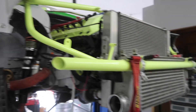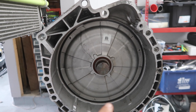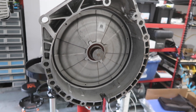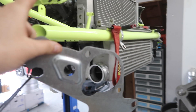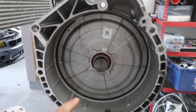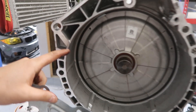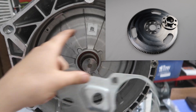Now the bolt pattern on this transmission matches the N54 and the N55, S55, and a bunch of other stuff. But the difference between the two is only very slight. For this family of engines to bolt to this transmission, you'll only need a few modifications. There's no need for an adapter spacer plate — no need for that big thick piece of aluminum that's expensive. We sell a flywheel that just allows you to bolt it up like normal.